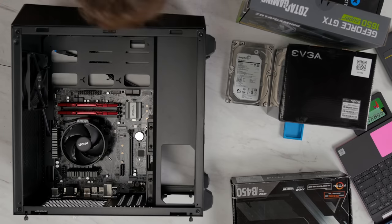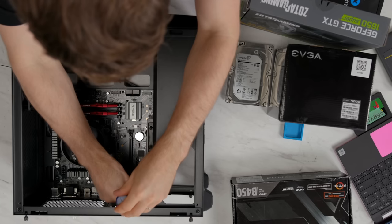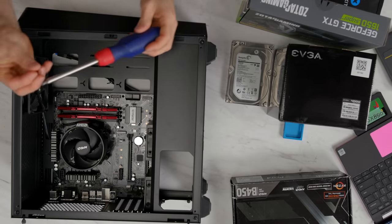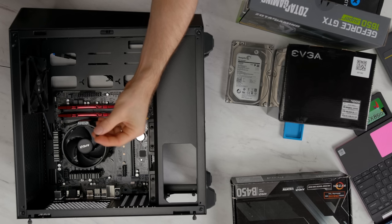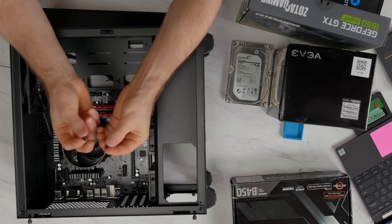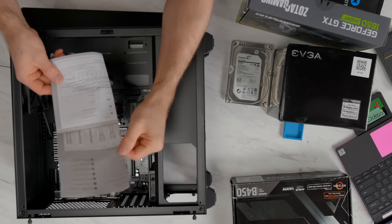For those asking about the parts list — if you're watching on YouTube, it'll be at the link in the video description with affiliate links for all the parts. When following along with this build, watch out: there are two types of screws included with the case. The coarsely threaded ones with hex-shaped heads are 6-32, and then there are the finely threaded M3 or M4 ones — the manual just says 'motherboard SSD screw' without specifying the threading standard.